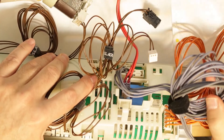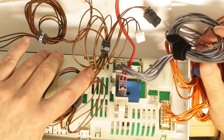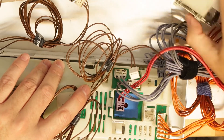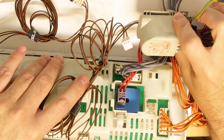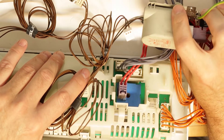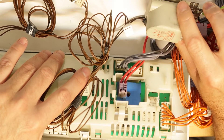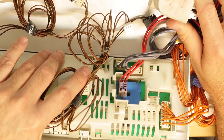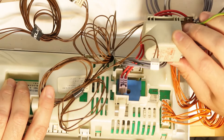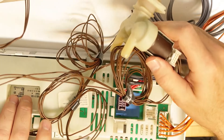This wider set of wires goes to the heating element, which draws the highest current on this machine. This connector is for the input coils — the coils at the mains entrance. I think it's some kind of protection filter, and possibly capacitors to improve the power factor of the motor. There may also be a capacitor on the motor itself.